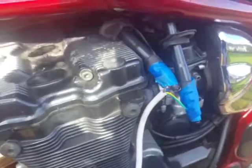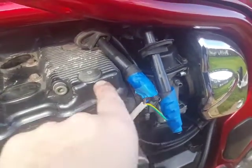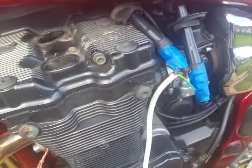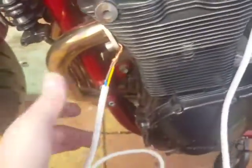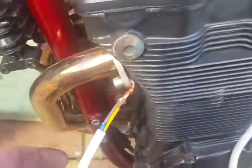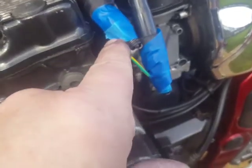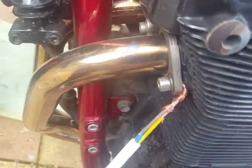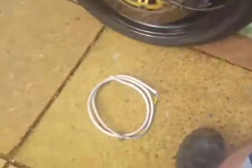This is what I've gone for — it's a bit belt and braces, you don't need to do it. If you're happy with your spark just arcing across wherever the plugs are near while you're cranking with no fuel, that's fine. But I've taken some household cable, stripped it back, wrapped it around the threads of the plugs, tightened it up, put some insulation around to stop it arcing across, and then earthed it to one of the manifold studs. I'm just about to do the same on the other side.